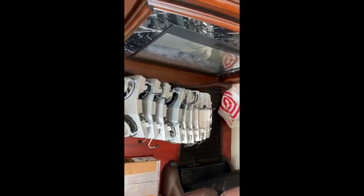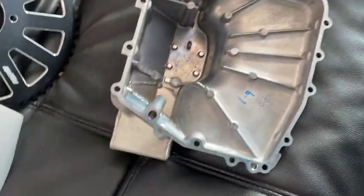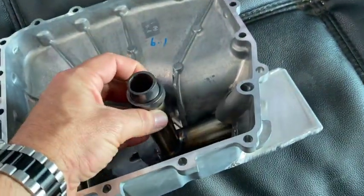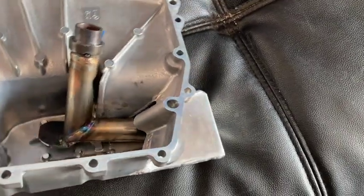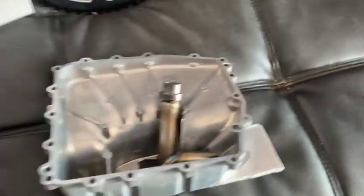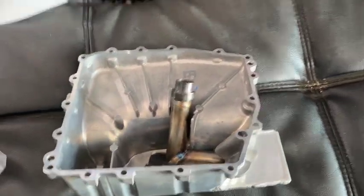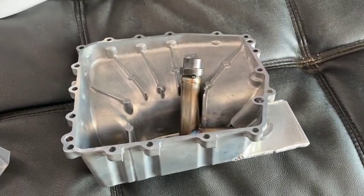A couple other products for the ZX6 — 2009 and up — there's this extended oil pan. This section here is added on toward the rear, and this is the oil pickup, so when it's in the bike it sits down inside that extended section. When you're doing a wheelie, it can never go dry — the stock one just goes straight down. Those are available with gaskets and magnetic drain plugs. They also work with the On Point baffle if you want the ultimate setup — I've tested it and they work together.